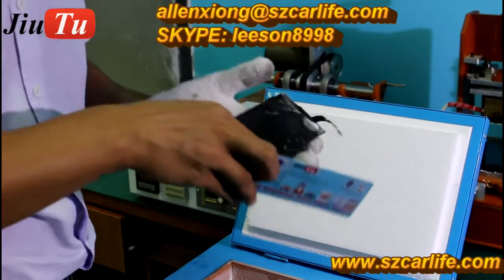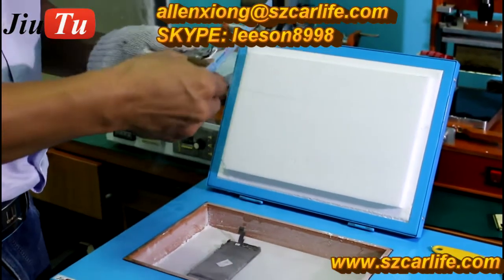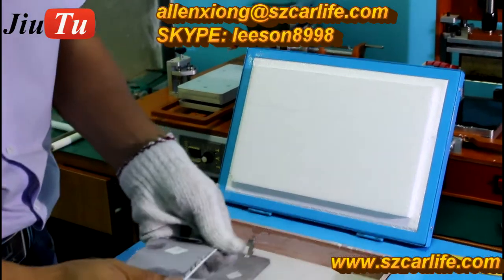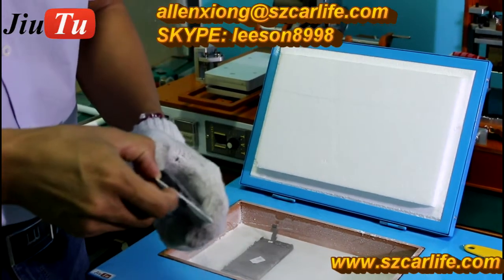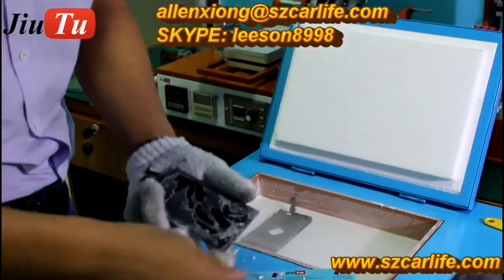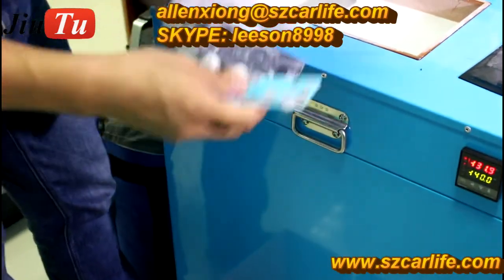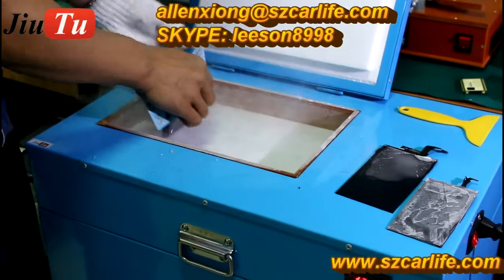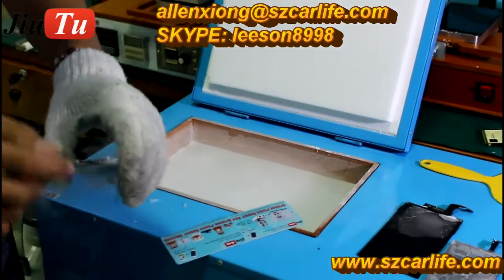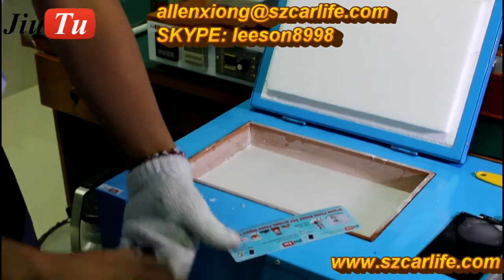Here is the first one — this is an iPhone 6 Plus. It is better to wear finger covers to protect your hands because the temperature is very cold over that area. If you find that the backlight is not flat, no worries — you do not need to do any adjustment. Just wait for it to return to normal temperature; it will go back automatically by itself.